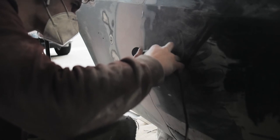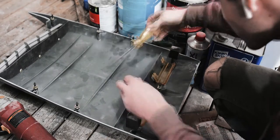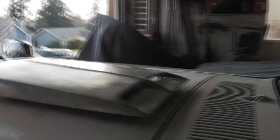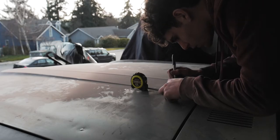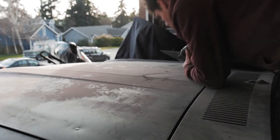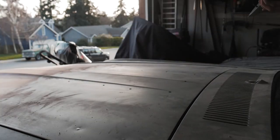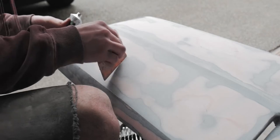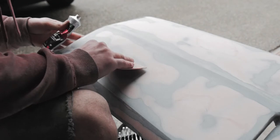I decided that I wanted to get a hood scoop for this car because they look very nice and have functional turn signal indicators, which is pretty cool. The reality is that you have to drill into your brand new hood to put them on. So I put it on the hood, eyeballed it, marked the holes I needed to drill, and drilled the holes. I had to take it back off because aftermarket hood scoops are cast out of fiberglass and are not perfectly finished, meaning you have to do bodywork on them.